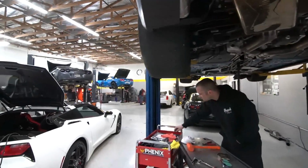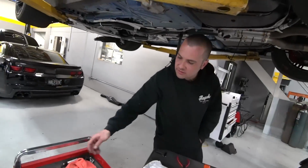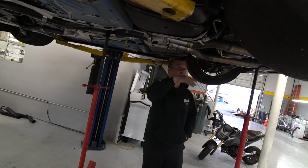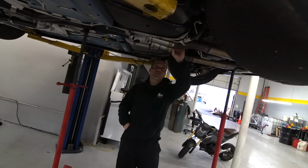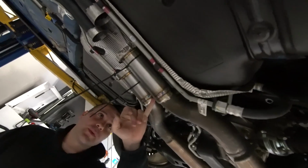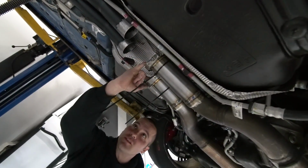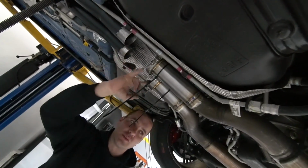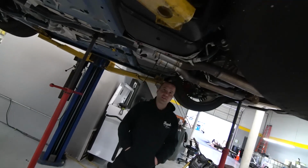Okay. Well, those pipes right there didn't mate up to the axle back, so I just cut it back some. Expanded the tube. It's 2 3/4. So expanded it and then welded in these straights and then these V-bands, and now I just need to connect these with some more straights. Nice. Some 3-inch pipe and some V-bands and call it a day.